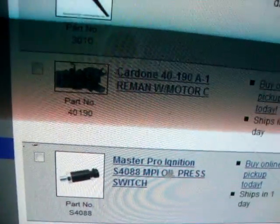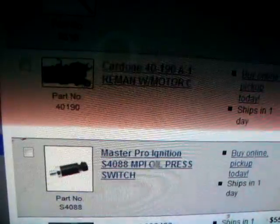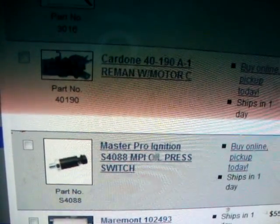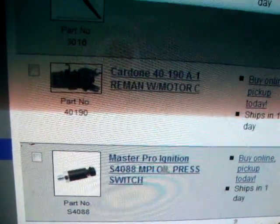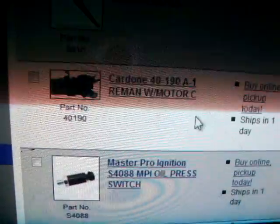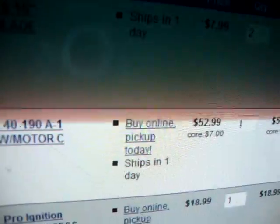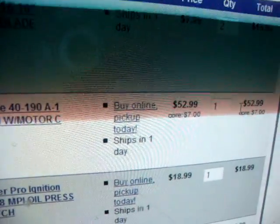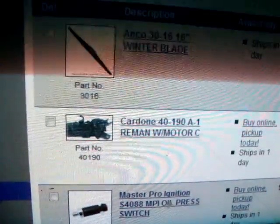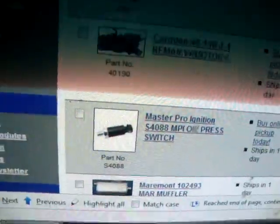Wiper motor — we need a new wiper motor. The wiper motor works on low but not on high. I actually think that's why I might need a new switch, because they put in too big of a fuse so it wouldn't blow, and they actually burned up the built-in switch. That'll explain why it doesn't work at all. A new one is $52.99 with a $7.00 core. I'm probably going to get a used one for $20 at the junkyard if I can find one that works, but they've been sitting on the shelves for several years.